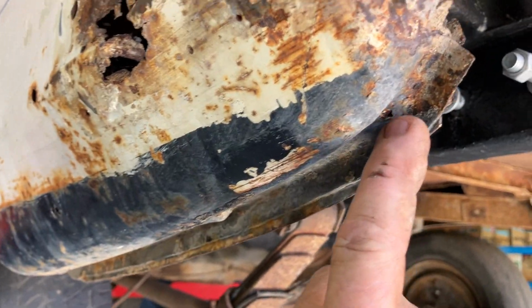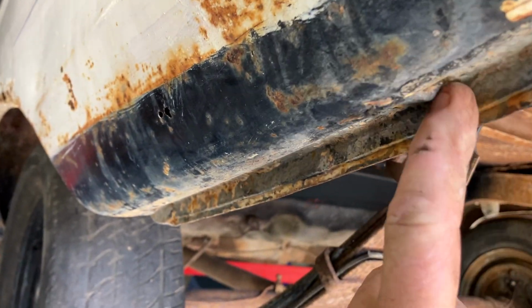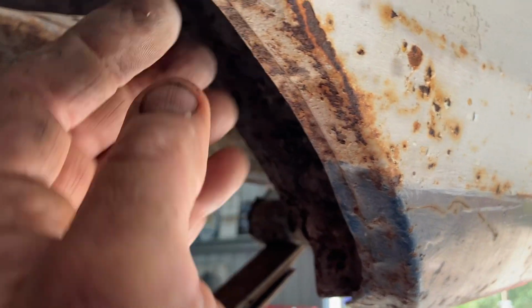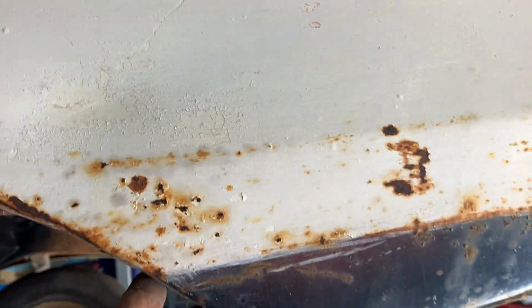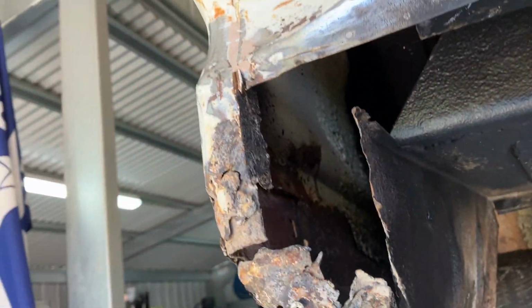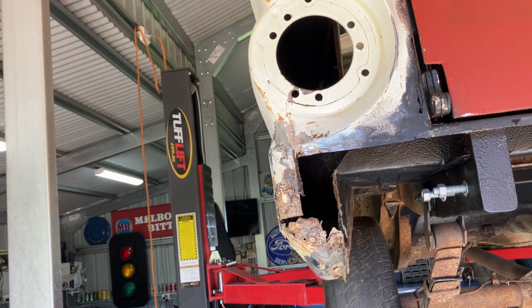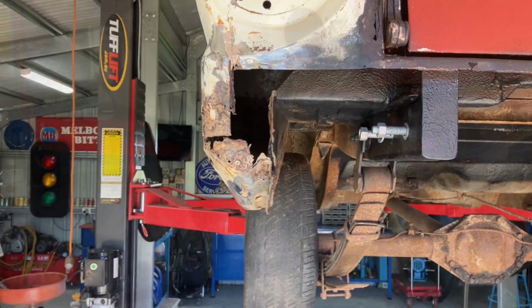first is, see that's double panel and it's spot welded. I'm going to clean along there because that inner bit stays, and up in here I'll clean along here and try and break those spot welds, and that'll leave the inner lip hopefully, and that's my guide. I think that's the right way to go. The cut along there is pretty self-explanatory, and the back's pretty self-explanatory. Yeah, that's as far as my thinking takes me, but let's have a go.